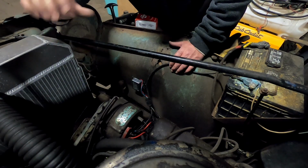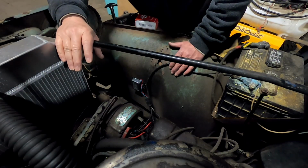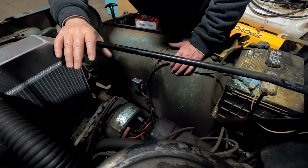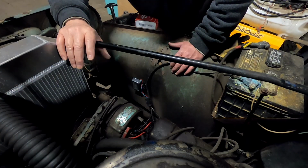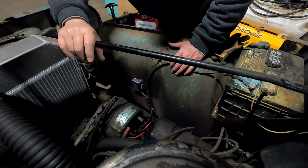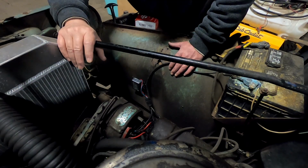So I'm gonna do one thing at a time. Like I said, right now, or in this case it's two, voltage regulator and battery. And then next I need to order a master cylinder rebuild kit. This is a '66, so it's an early CJ5, which means it's got Kaiser Willys running gear, not the later AMC. That being said, it's got the old master cylinder down on the frame under the driver's floorboard. So it's a little tricky to get to. It ain't up on the firewall like modern vehicles. But at some point, I gotta pull that out and rebuild it. I gotta find out where my hydraulics are leaking, if I need to replace a hose, or if there's a fitting that needs to tighten up or whatever. But the brakes, I'm really tempted to wait till the spring, because if I pull that all apart, this thing's down, and if we get a snowstorm, I can't even pour fluid in it and get it going good enough to plow with.